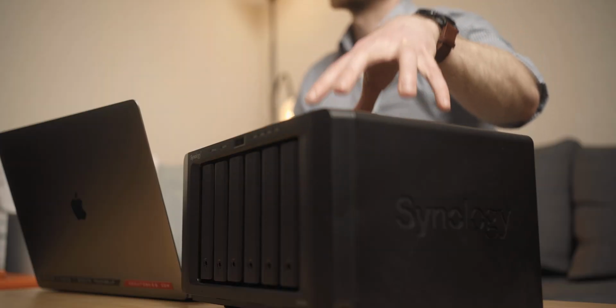If you go for a sync task, that's even more interesting. Not only will everything on our computer end up on the NAS, but whatever is added to the NAS will end up in our folder. Just imagine you are going for video editing collaboration: we introduce another editor to our project, a colorist, sound designer, whoever, and they create some digital assets for our project. We can give them access to our NAS over the internet so they can upload those digital assets, and once they end up on the NAS, they will be synced automatically to the folder we're using for editing on our local computer, which allows us to get even better speed while editing. Everything will be done automatically. Another cool solution. So let's go for the sync task.